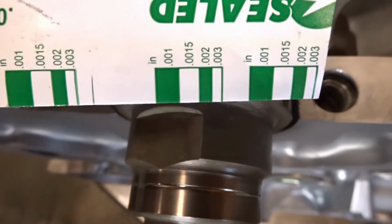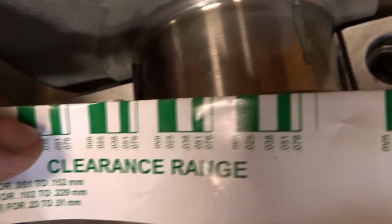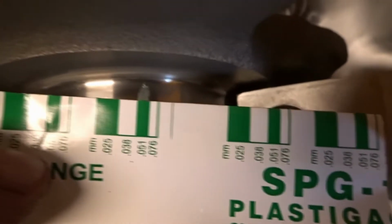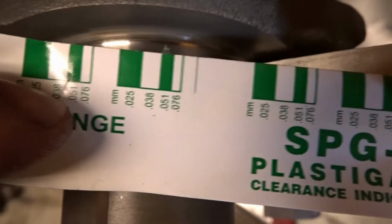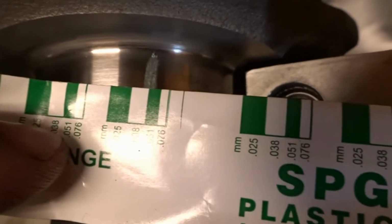On either side of this, on this side, I believe is in inches. So it goes from 3/1000ths of an inch to 1/1000ths of an inch. And on the reverse side, it gives you from 0.025 to 0.076 millimeters. Now, I already looked at this, and it seems like the size and color matches up best to 0.051. Really, we want it to be in this 0.038 territory. If anything, I'd say it's on the bigger side of the 0.051,